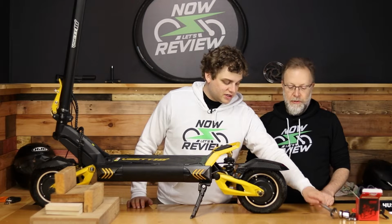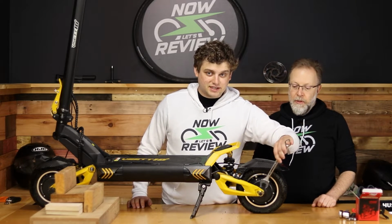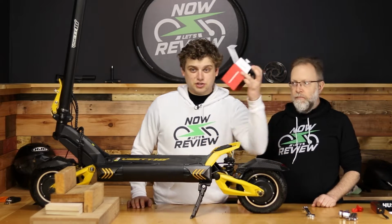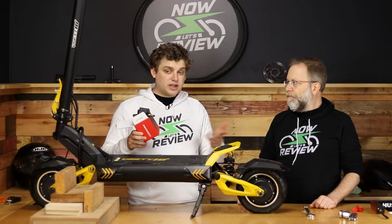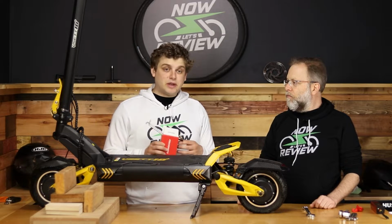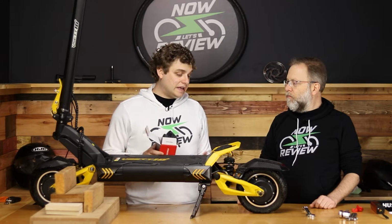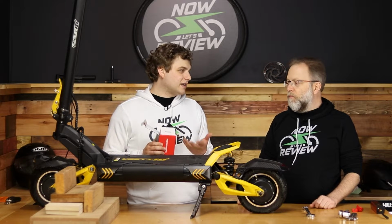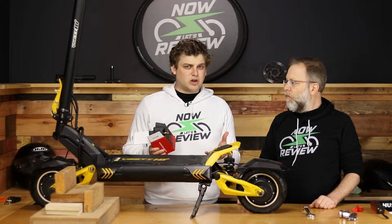All right, so first of all, you're going to need some kind of wrench to be able to get the wheel off. Then you're going to need the proper inner tube. You can find that out either by Googling whatever kind of scooter you have. That's going to be pretty available information. And if for whatever reason you can't find that, once you take off the tire, the inner tube will probably say it on it. It'll take a little bit longer, obviously.